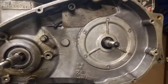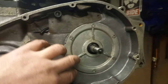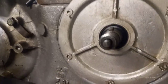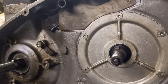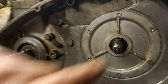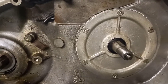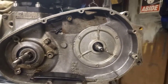In the meantime, I've already fitted the new drive sprocket as I mentioned I would in the last video. I've fitted this trap door with the oil seal in the correct way - most people fit this seal back to front. It looks like it's fitted in backwards from what you'd normally expect to see; the flat edge points towards the sprocket, the edge with the spring retainer is facing out towards the clutch chain wheel. I've already fitted the keyway - reused the old one but it's a good tight fit. I've fitted a new gasket on there, got that from eBay from British Bike Doctor.